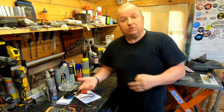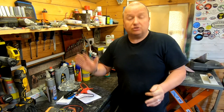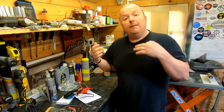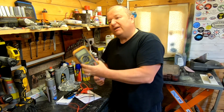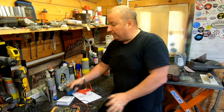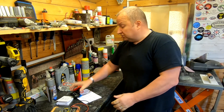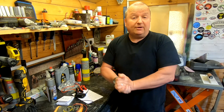This does car batteries and bike batteries. We also found that if there's not enough voltage in the battery it won't connect to Bluetooth at all — and a battery that won't connect might not be bad, it might just be flat. Once charged it could still be a good battery, but without Bluetooth connectivity you can't find that out this way. This device measures from 6V to 12V batteries. Anyway, this is my first time using this product — I hope it gives you an idea of what it can do if you're not sure how to use a multimeter. Thanks very much, see you in the next video.